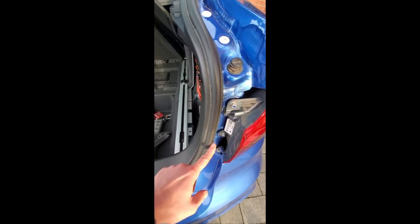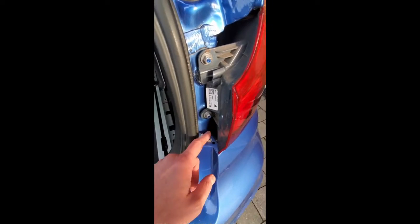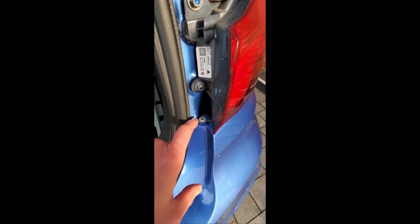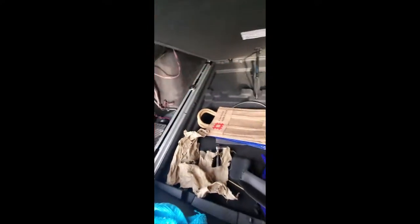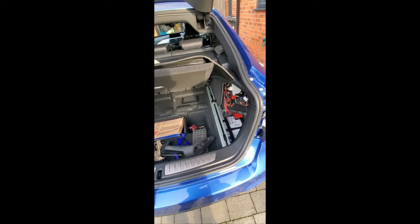And it's obviously both of these sides are internally, there's like that, you can't see it in there, but obviously down into this little piece here, this cavity, and it just sits down the bottom like a reservoir, because the water was actually down in the amplifier corner, like right down in here. It was actually rising, the water was coming up, and it was bone dry, wiping it, and then it was actually rising and rising, so it's obviously fills in like a little cavity down there, and that's that. So hopefully that's of some help to some BMW owners.